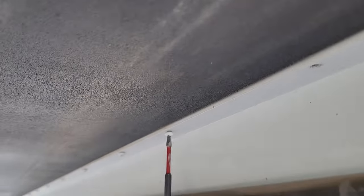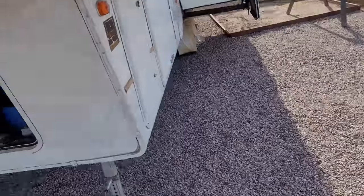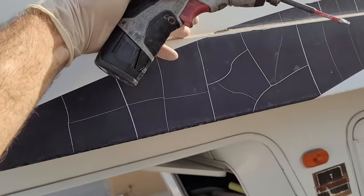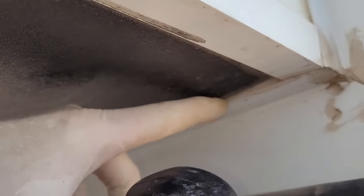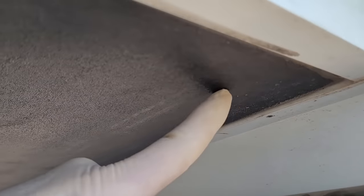What I wanted you to see is it's not just a problem on the side — now you can see all that rust, so water's getting in the front too. The fascia has the sidewall behind it, and water will come down and get behind this bead of silicone. Once it gets behind there it gets stuck on this lip, and for some reason they sealed that too — they definitely shouldn't have sealed that because it won't let the water out if it does get in there. Then you just have water sitting right there, wicking into the plywood.